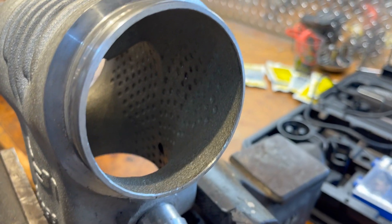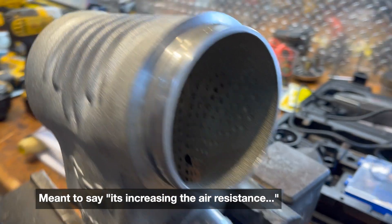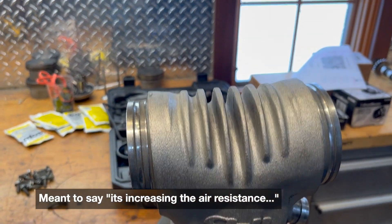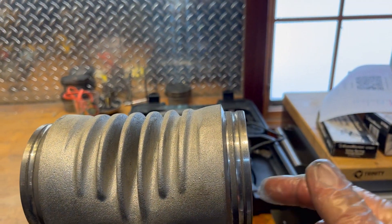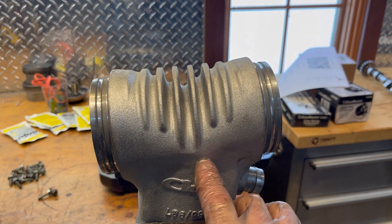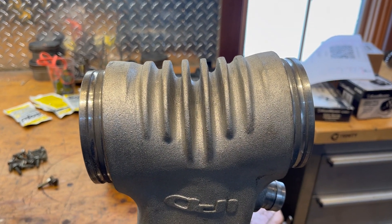The surface is rough, so if anything you're increasing air resistance. We're going to do two things. Number one, we're going to take off these cooling fins — that's going to save weight. It's also going to minimize heat transfer from the outside to the inside, because those fins effectively catalyze heat from the warmer engine bay to the inside, increasing the intake air temperature even more.